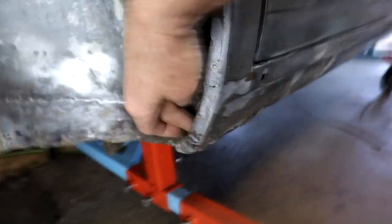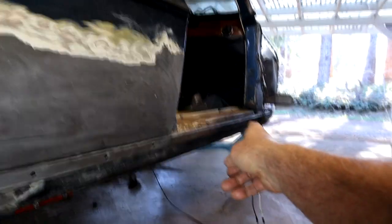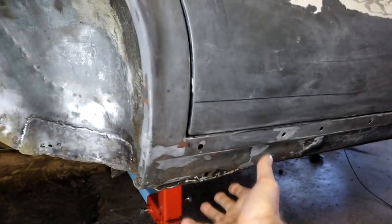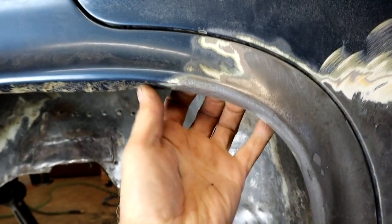We've got regular holes in the rocker section — I'll have access once I remove this section. The repair we did earlier up front is holding well, and there are some small holes in the floor pan I can address. The rest of the floor pan on this side is actually in pretty good shape. We've already repaired the bottom of the door that was rusted out. Once I open up here I can replace the jacking point. The underside — the dog leg, the box section underneath — is good. The inner arch on the outer has typical stress damage and a little corrosion.